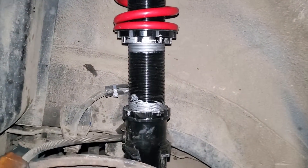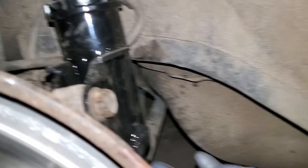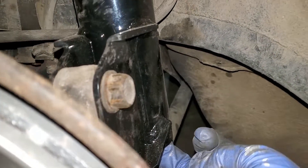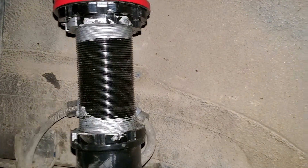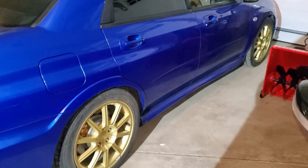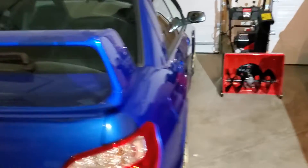Something I wanted to show you before I put the car down: make sure you take a measuring tape and measure the bottom of the coilover — you want to get the same length on both sides. I measured mine and they feel the same. Measure from the base to the top ring; both are 10 inches, so the ride height should be identical. All right, she's on the ground — she's stiff and pretty symmetrical on all sides.